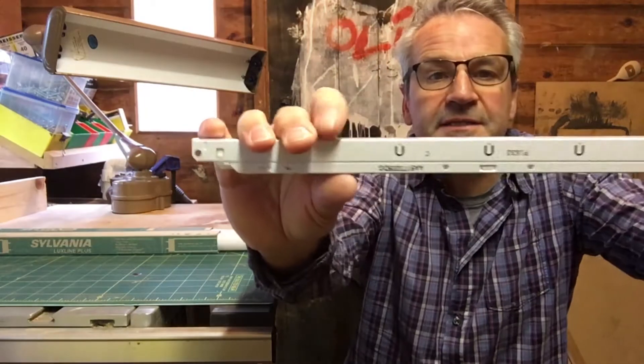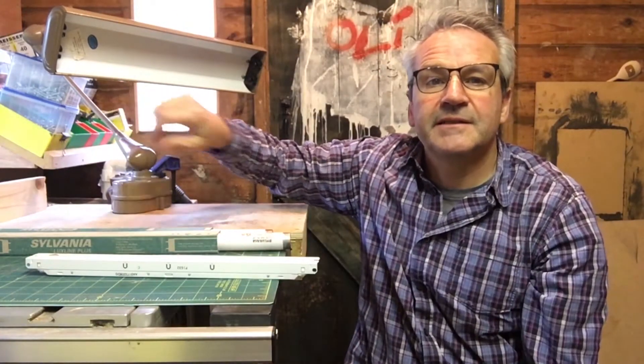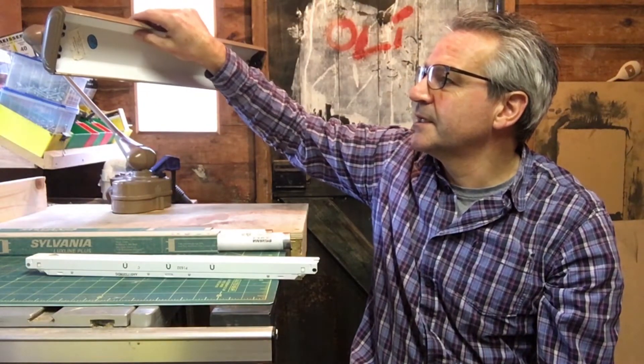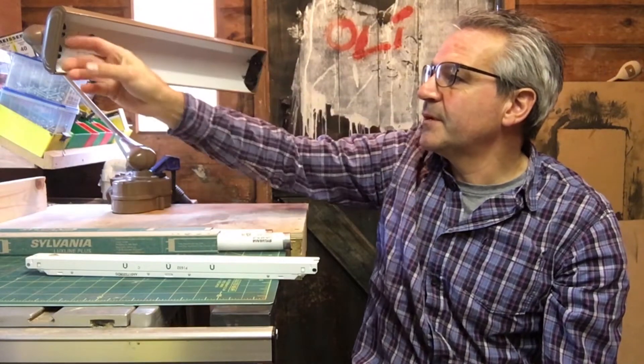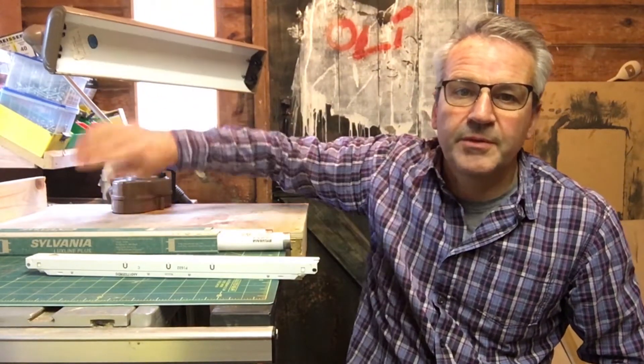The other problem is the thickness of this ballast is about two centimeters and the space I've got in here is only about one centimeter. With a bit of squeezing it should fit in this angle piece — it might push things out a little bit, but hopefully I won't have to trim any of the metal. The first job is to remove the bottom, take out the old broken ballasts, and pass the wiring straight through to the top, because the new ballast is going to be mounted in the top rather than the bottom.